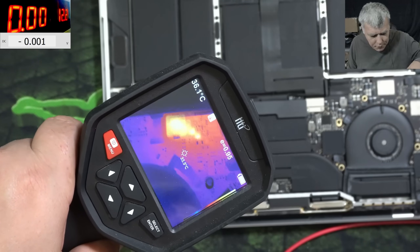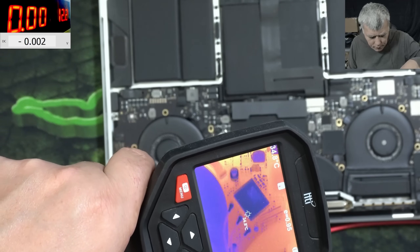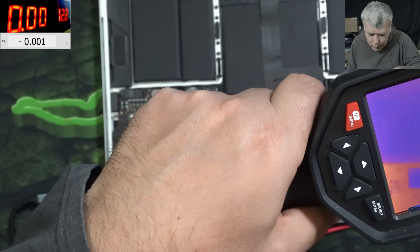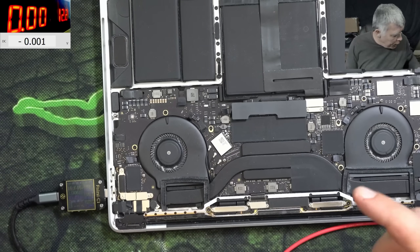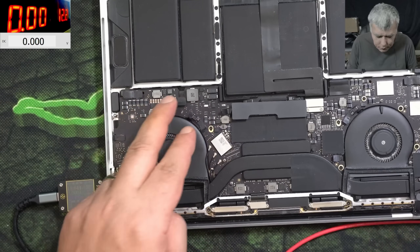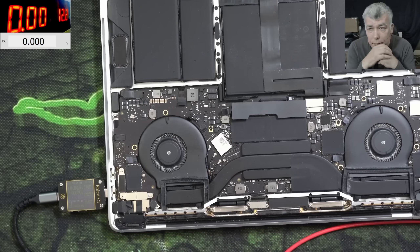If you think that 10 ohms thing probably will get hot because it has some resistance — but no, I can't see anything. Nothing. A dead battery? Some people will think it's a dead battery, but you can't check a dead battery having 10 ohms because the battery is behind some MOSFETs in series with the power rail. So that 10 ohms didn't come from the battery.